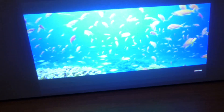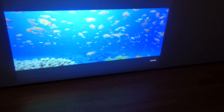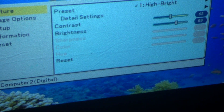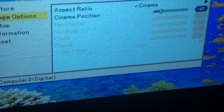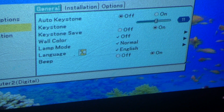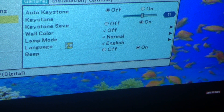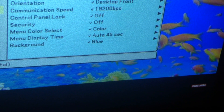So I can get out of the way real quick to adjust this. You'll see right here that everything is in mirror mode. There's a way to actually alter and change all this. What we're going to do — I have to put that piece of paper there to level off my projector — we're going to bring the projector back around. Now we have the projector back around. We're going to adjust the focus a little better. We're going to take the remote control and go into menu. Now, let me zoom up on the camera here so you can see this. When we're in menu, we're going to go over to images. You can go to keystone anywhere — I'll show you how to do it in keystone — but this is how you change everything around because everything is going to be completely in mirror mode.